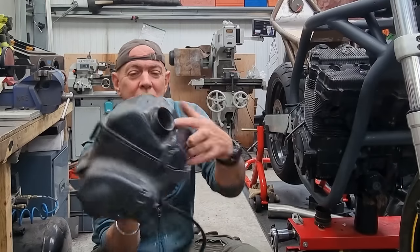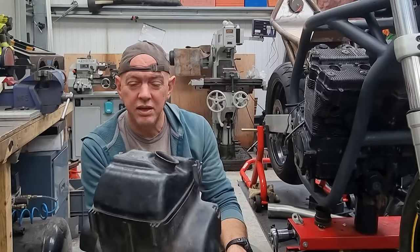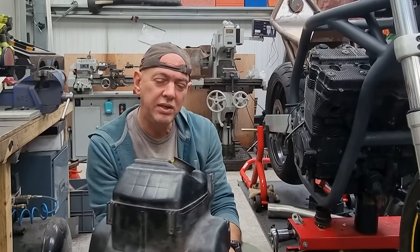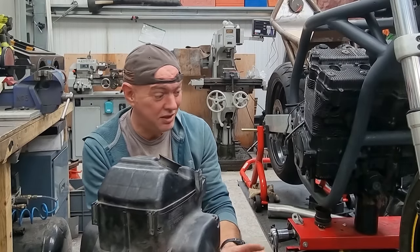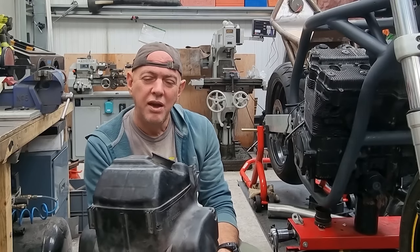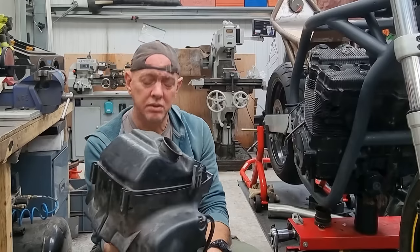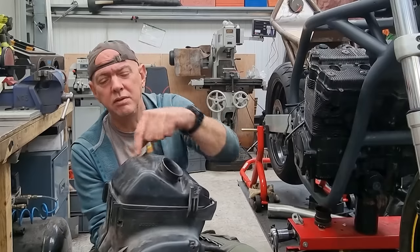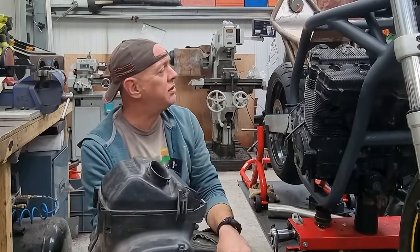The other thing that's important is that hole. That is the only way that air can get into the system once it's all bolted down. And it is that size for a reason. There was one fella I was watching on YouTube. This is why you need to take everything with a pinch of salt if it's on YouTube or anything, because everyone knows everything apparently. But there was one fella who was going on about, well, that's a restriction. Yes, it is, you're quite right. So if you just drill loads of holes in here, you'll let more air into your airbox, and then you can increase the jet size on your carbs.